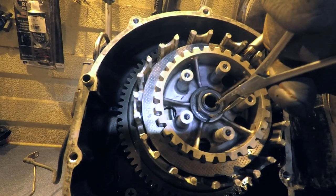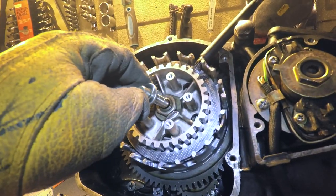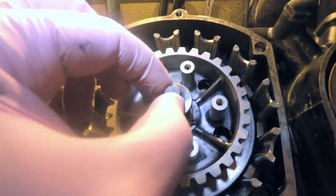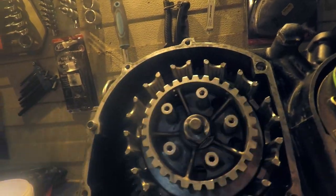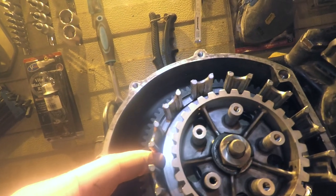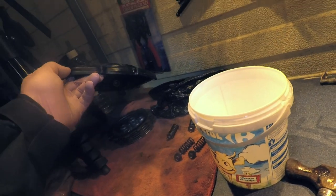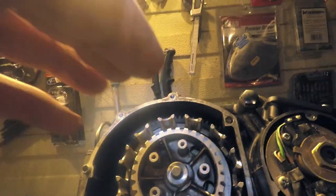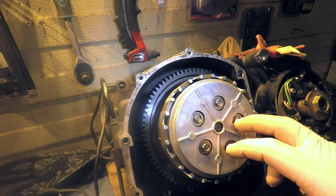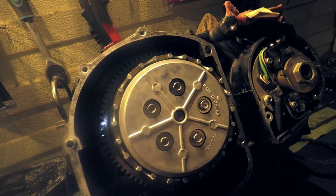I took that circlip out and this thing comes off — and that's the oil pump. There's a pin here that falls out, then 10mm bolts. The screws that hold the oil pump are the same size. There's a washer here — actually two washers, a thick one and a thin one with smaller diameter at the back. That's the main bearing. For putting back everything, you do it in reverse order. The manual says 50 to 70 Nm torque — I'll go with 65. Make sure you bend the washer tab back and don't grab the pump shaft. Clutch disc goes straight on the aluminum first, ends with a clutch disc on top. Remember to oil the clutch discs before reassembly.